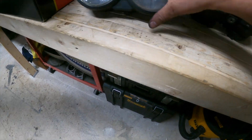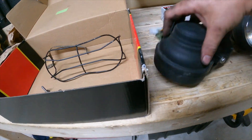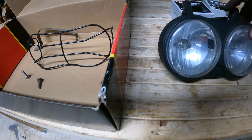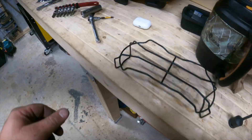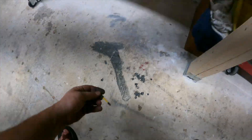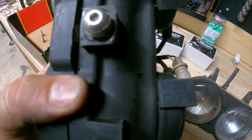I can tell this is actually a factory part — they're both stamped USA. They both have this ridiculous bolt on the bottom that somebody couldn't get off and clearly broke. Now you can see better that melted lens. Somebody has tried to seal it with silicone. The bulbs both work, which was the strange piece. This smart person had regular 10mm bolts in there instead of the stupid bolts that required some complex socket and nut driver arrangement. As for this bolt on the bottom, it's torqued but also chewed up. Buell — I know you're out of business — but the amount of weird-size Torx and American hex head bolts you used: thumbs down.